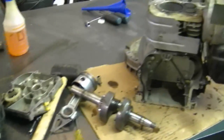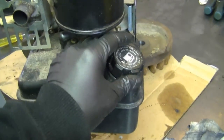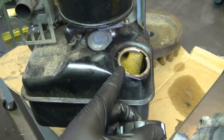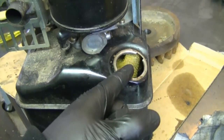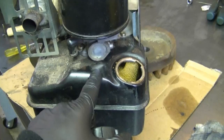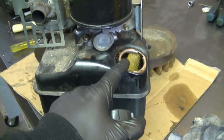What I'm going to do is put this engine in a box and store it properly. These metal tanks have a tendency to rust inside, so I'm going to take out the fuel first so it doesn't go bad in there, and then I'm going to spray it with oil inside here just to prevent rust. I did replace a fuel tank like this on a rototiller this spring and it cost a hundred and some dollars just for the fuel tank, so it's well worth trying to preserve them. Thanks for watching, and we'll see you in my next video.